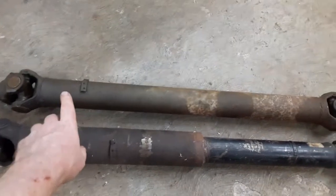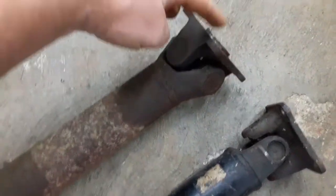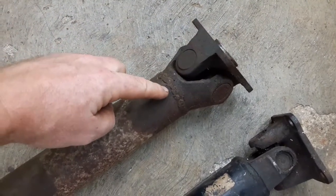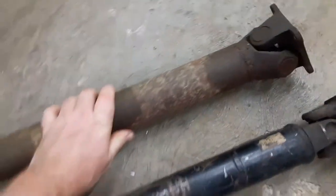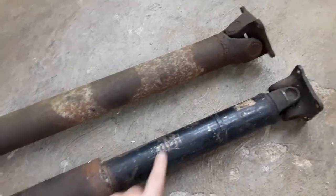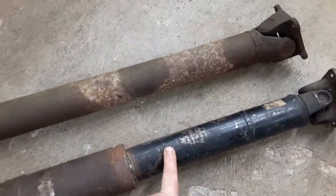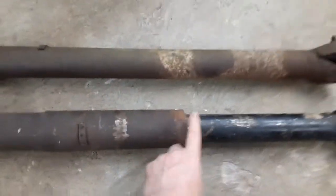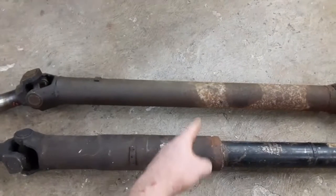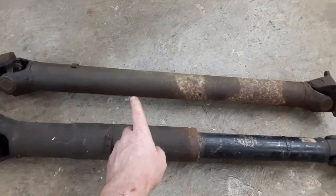this one based on the length I needed. So what I'm going to do, because I need a drive shaft now that's shorter, and I marked it on this end — I need this flange surface to be right there. So instead of cutting up this drive shaft, which is still a good drive shaft, I'm going to chop this one again, remove a section, make another mock-up, install it in the car, and then take it to a drive shaft shop to either shorten this one or get a new one made, which is probably what I'll do.